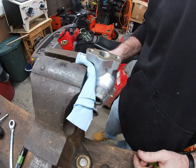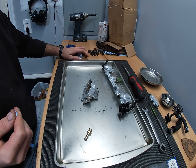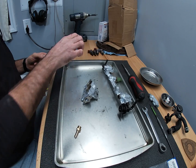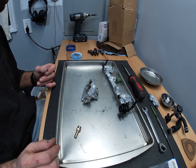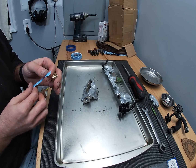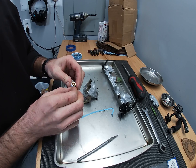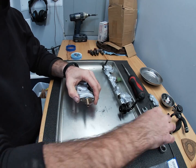The next thing we're gonna do is use Teflon tape. NPT threads have a taper to them so you want to use good Teflon tape — I'm using Blue Monster, which you can get at Home Depot. Make sure whatever you're using is rated for oil and gasoline. I cut the Teflon tape in half lengthways so I could wrap it around the fitting without a bunch of excess sticking out. The instructions say to wrap it a minimum of three times; I did it about five just to make sure I didn't have any fuel leaking.